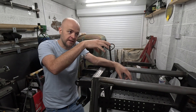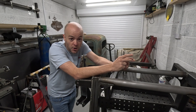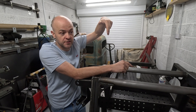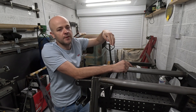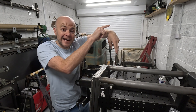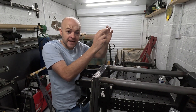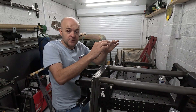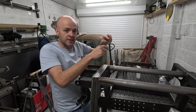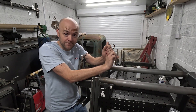What I did was remove and insulate the CAN bus wires that went to the power steering pump — the original Audi A1 ones. It's the orange wires: orange and black, and orange and brown, usually twisted, going to a four-pin plug with three wires. One wire is a switch 12 volt — leave that one. Cut the CAN wires and on the Audi loom side, insulate the ends so they can't touch anything and tape them back. Leave those because they're still running CAN signals. Then the two wires that go out to the plug, wire those into the Fabia CAN bus side.